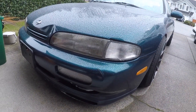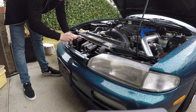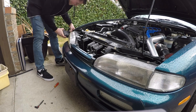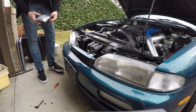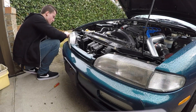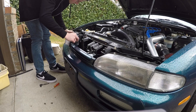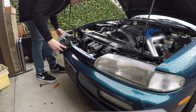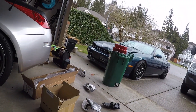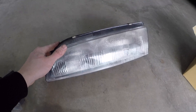Anyways, I'm going to get started on this — just pop out the headlights and start ripping the lenses off. All I've got to do is pop these clips out without breaking them, heat up all the sealant, pop these out, and then smush the new ones in there.